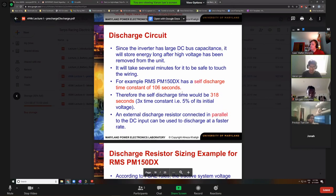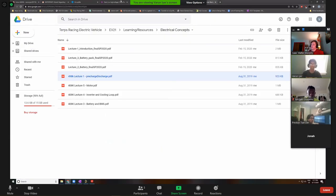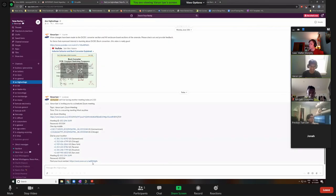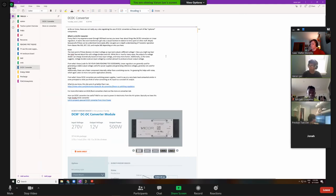There's an internal relay driver built into the inverter, but we generally don't want to use that because it limits our control over the relay. We can also talk about the discharge circuit — it's kind of the same deal, just a little different. So that's how pre-charging works: why we need it so capacitors in the inverter don't go boom, and how it works using a relay to switch a resistor in series between the battery and the inverter.